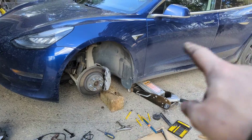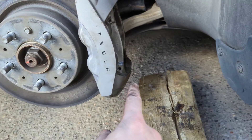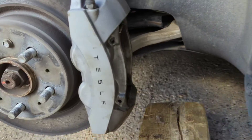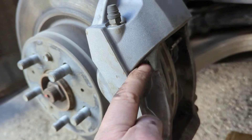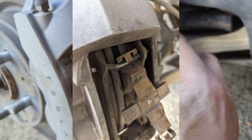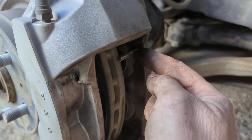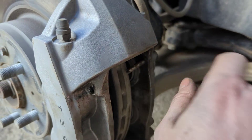I'm doing my seasonal tire swap from winters to summers and wanted to do some brake service — it's been four years. I went to take out the two pins and the bottom one came out, but the top one, as you can see, is just seized in the back. As I was tapping it, I noticed it bent in the middle. It's not supposed to do that — millions of videos online show you just punch it out. So I took my Dremel tool and cut flush there, then tried to punch the rest out with a punch tool.